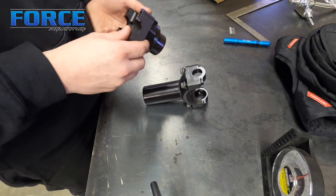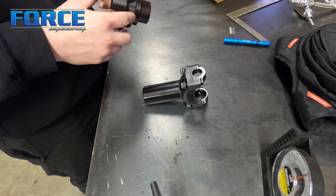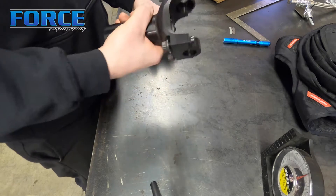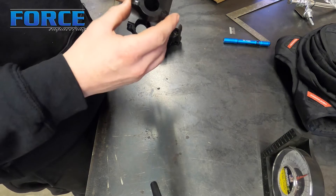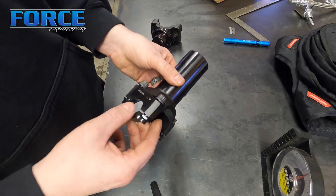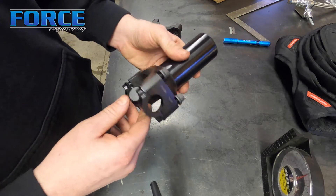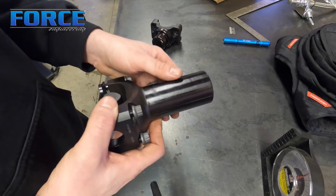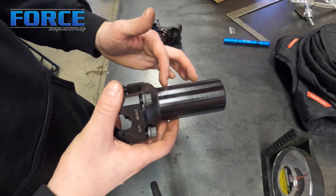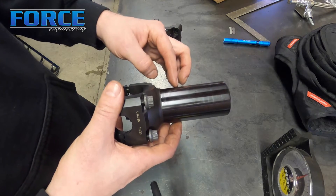The trans is 100% in, converter bolts are tight, and the shift linkage is hooked up and adjusted — remember to do that with the shifter in neutral. Next we need to put the slip yoke in. This is a billet cap removable-cap piece, part number U1678N — a hardened yoke due to the roller bearing tail housing on the Rossler Turbo 400. When measuring drive shaft length, push it all the way in to the seal and pull it out an inch.